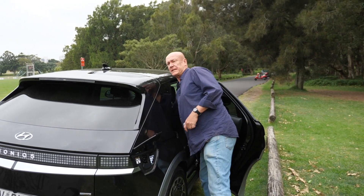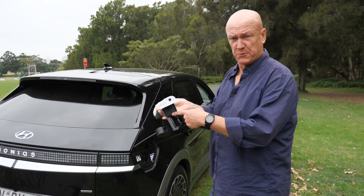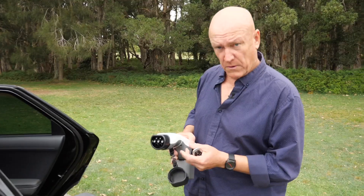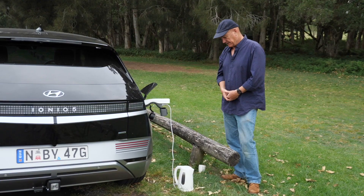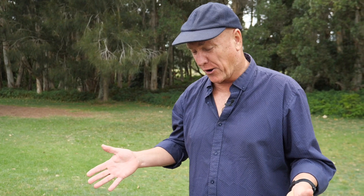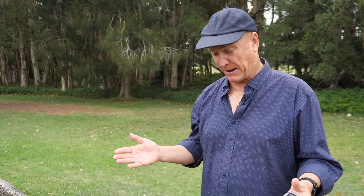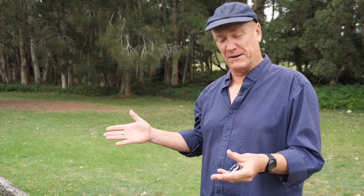Let's see how that works. You need a special adapter to convert it from DC into AC — and here it is, just a normal standard 240-volt plug. We put this into the charging port. Here it is — the car boiling a kettle. The kettle probably has an element requiring three or four kilowatts. This car can deliver 4.6 kilowatts, which is plenty for most appliances and power tools. And if needed it could probably power your house for about a week, which is quite amazing.